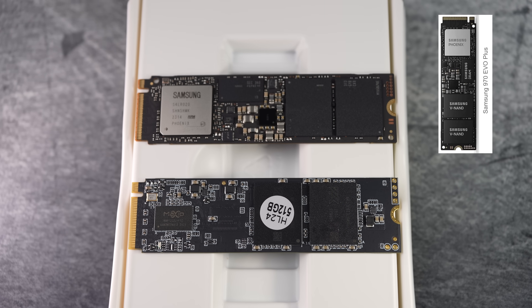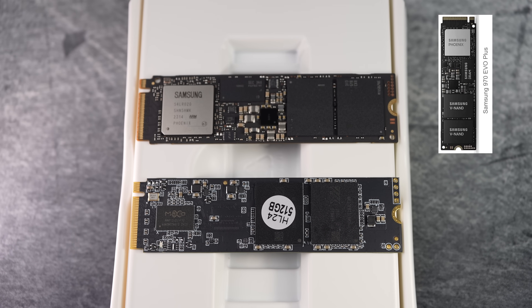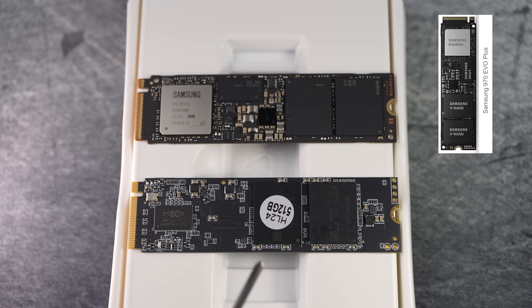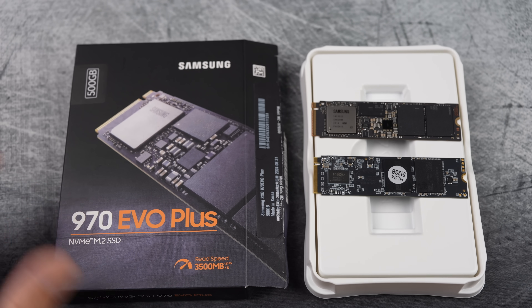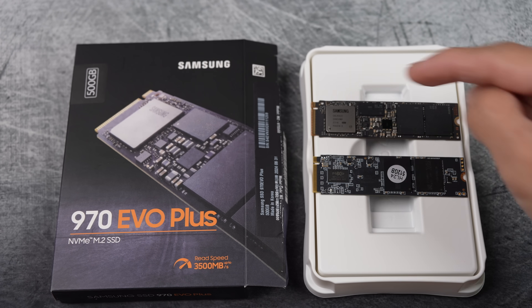Here we have the two drives side by side. The real one on top shows a well-designed layout. The real drive includes DRAM, which is completely missing on the fake one. Here are the two NAND chips on the real one — the storage chips. And here are the NAND chips on the fake one, which are likely low quality. Exact same copy of the label on the back. The fake box even bluntly printed the real drive's chips right on the package.